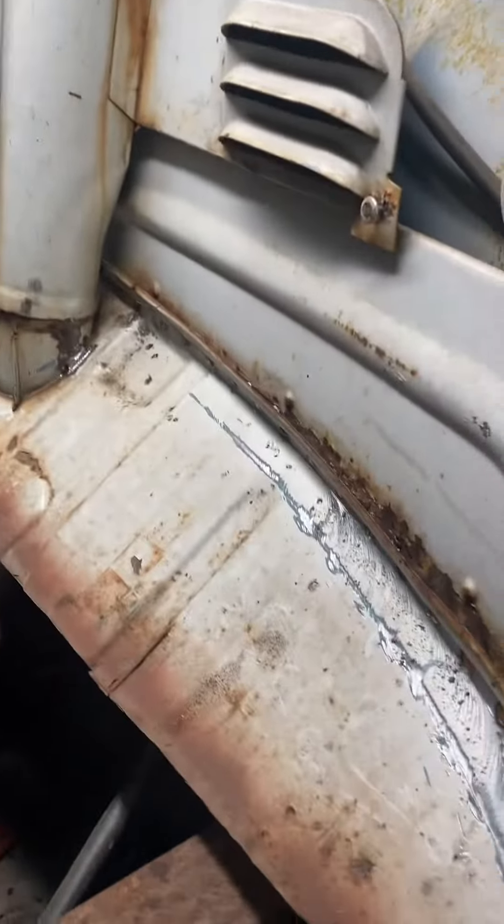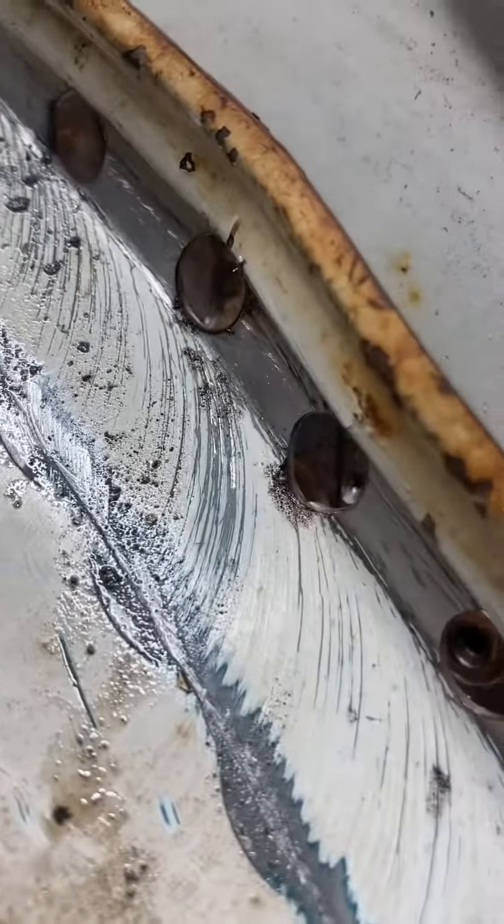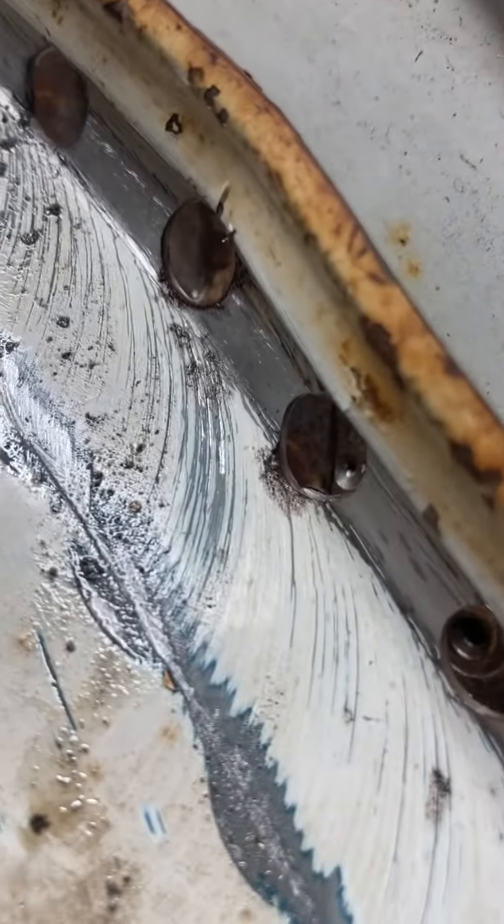What you don't want to do is drill all the way through the piece of metal in the back, which you can avoid in a couple spots — all those are going to be ground off. But basically that cuts right through and leaves the spot weld kind of intact in the center there. Then you're going to grind that off.